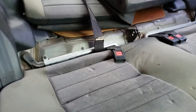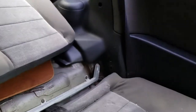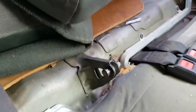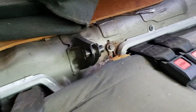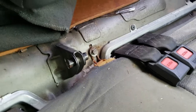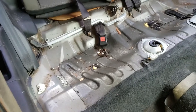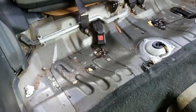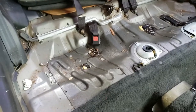The back parts of the seat are taken out. Once you pop that little clip out, you can slide the seats towards the windows on each side and it'll release from the little studs. There's enough room to slide it over — just be careful, push the fabric in when you do it. The bottom seat cushion has a 10-millimeter bolt; get it off and the seat pulls right off. Once you remove that bolt, rock the seat forward and pull it out of the tabs. Go ahead and collect all the change dropped by passengers over the years and clean up any nastiness down there.